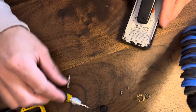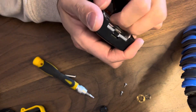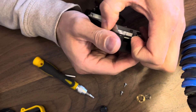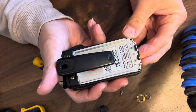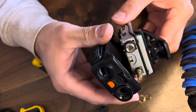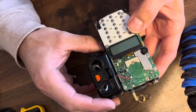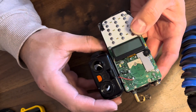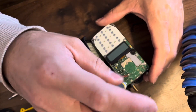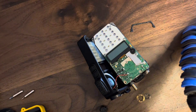As you're taking this apart, you might think you should take off the belt clip — don't take off the belt clip. It actually gives you leverage to pull the unit out. Using the belt clip, I actually lift the unit out of the body, and it's much easier this way than trying to pry it out with a tool. Leave the belt clip in place — it's a sturdy belt clip, it can handle the force. But be gentle, as your speaker wires, the red and black wires, are permanently fixed into place. It's not something you can just jerk around — you'll have to solder it back together if you break the connection.